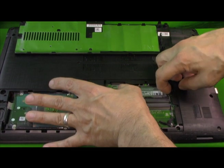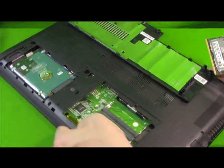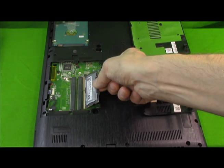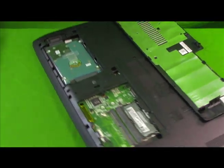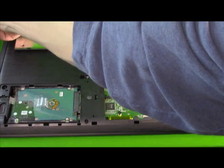We'll show you again one more time from a side angle so you can see. Pull the clips apart, take it out. Go ahead and slide them in, match the hole up, push it in and down. Click. That simple. Then go ahead and do the same for the other RAM stick.